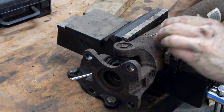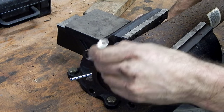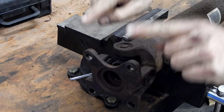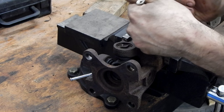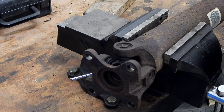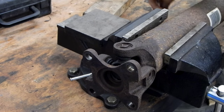I've scribed a new mark into the drive shaft tube to where our U-joint goes into this other part of the yoke. The idea is that when we remove the U-joint, I want to assemble this part back the correct way — the same way it was on the drive shaft. When we put the drive shaft in, it's back on the exact same bolt it was on the flange, so we're not upsetting any of the factory installation or how it was balanced. We're putting it back identically, albeit with new U-joints.